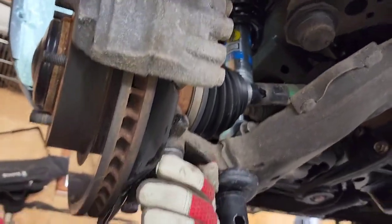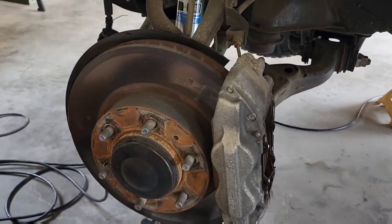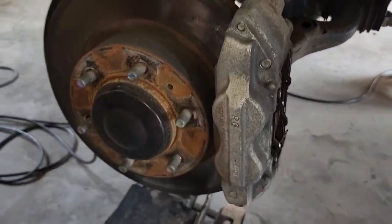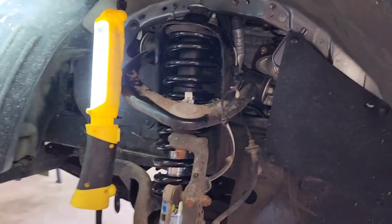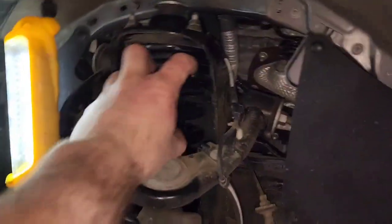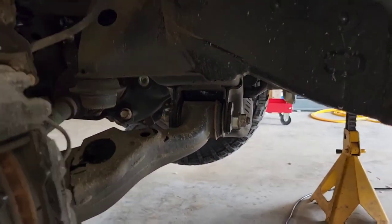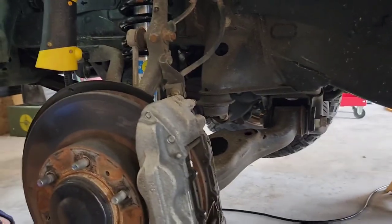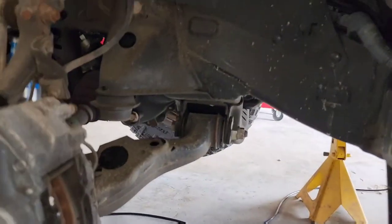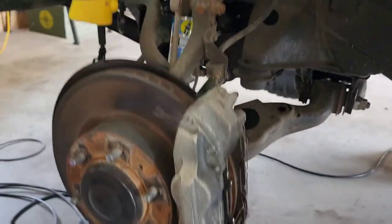So this stuff's basically it and now it's just a matter of tightening everything down. It's really easy to do — you basically loosen off the camber bolt and the one on the front, take off those two bolts one on each side of the castle nut at 118 foot-pounds torque spec, and then you can drop the whole control arm and pull the OEM strut out. Put your new one in, use the truck to compress your spring. Don't tighten your camber bolts until the truck is back on the ground with weight on the spring — otherwise you're preloading your whole setup.